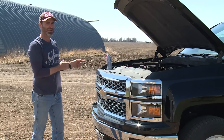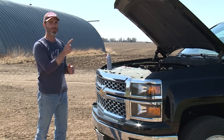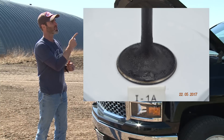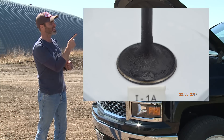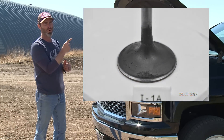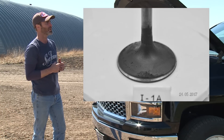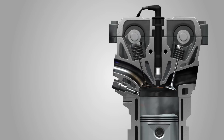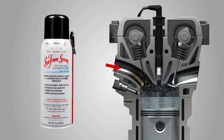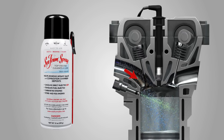Alright, we're all done with our second spray treatment — boot's back on, everything's back to normal. Here's the deal with Seafoam spray: check out this intake valve. This is a GDI intake valve with 6,000 miles on it, and it already has a considerable amount of carbon residue built up on the back of the valves. After one spray treatment, Seafoam spray removed more than 80% of the carbon weight on the valve. Now check out this GDI engine diagram — notice where the fuel injector is positioned inside the chamber. The only way to clean and reach the intake valves is by using an air intake cleaning treatment like Seafoam spray.